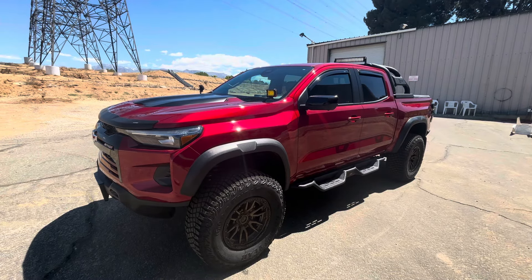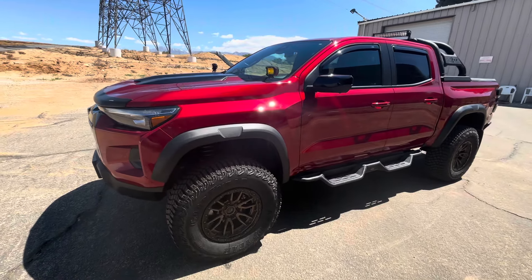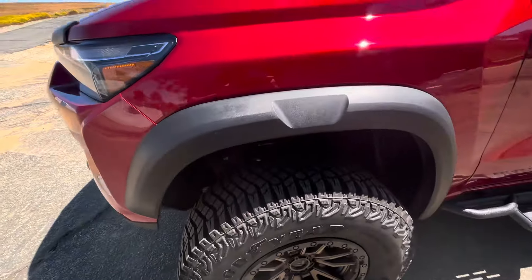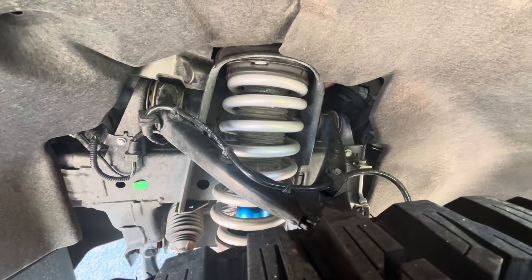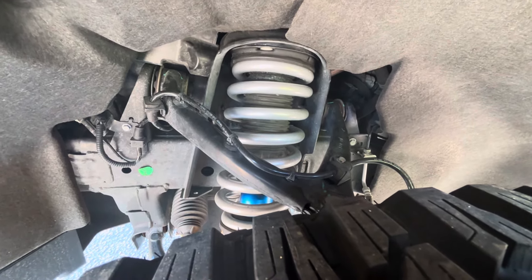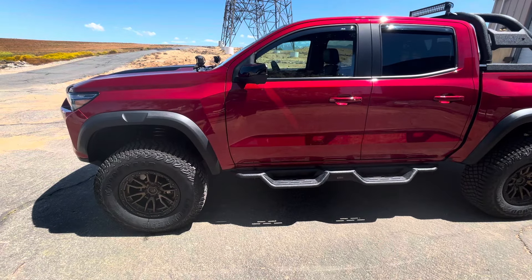It's been a while since I did a full walk-around with the mods. Basically the newest thing I've done is put the 35-inch tires on the truck and the new suspension, which is the Eibach ProLift. I also got the Peak Suspension one-inch spacer up on the front, so it adds about two inches all together. It's a ZR2 with that kit in order to fit the 35s.